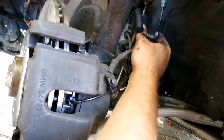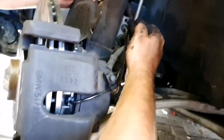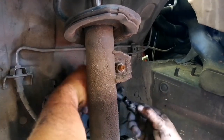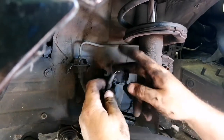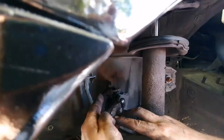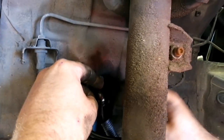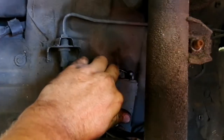This piece will then go to the back here behind the stabilizer and click into that gap. Your new wear sensor will clip into this. On the wire you'll see two retainers — one on the thicker tube and one on the angle. The angled one goes into the box and the thicker one goes onto the body anchor. Clip it onto there, open up the box, click it back into place, put the connection into the box, and close it up.